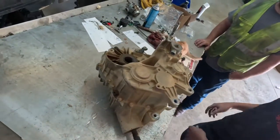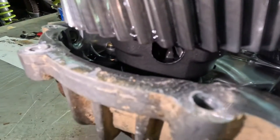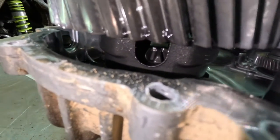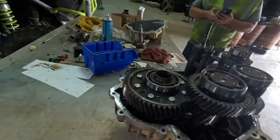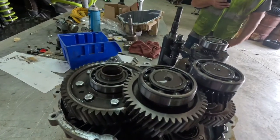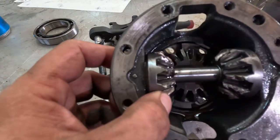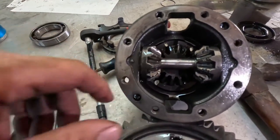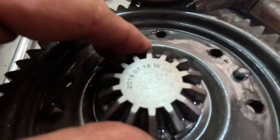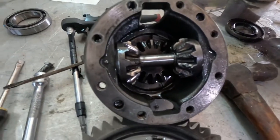We finally got it out, we're going to open it up and see what the insides look like. We got it open and it's hard to see in there, but there are some spider gears inside that are busted. Most of the spider gears are chewed up — a lot of times those pins will break too. These aren't actually that bad, it's just those side gears, but we're going to do a spool and get rid of all that so we don't have to worry about it anymore.